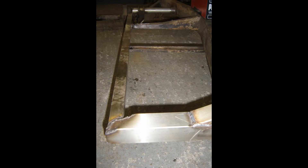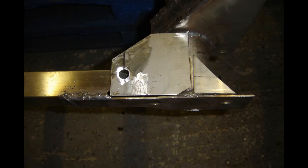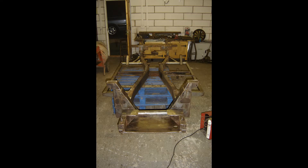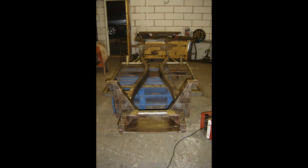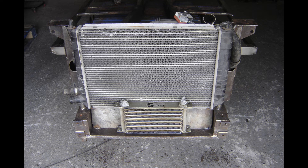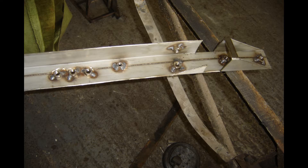That's the now stainless steel outrigger, front to back. You can see the original repair in the back and the new repair in the front. These are some gussets to go on the top of the back end which strengthen it again where the seat belt mounting point goes — and the other side. Those are the major repairs to the outriggers: a bit of plate, a re-adaptation of the front end to suit the new radiator setup and the 19-row oil cooler for the new engine.